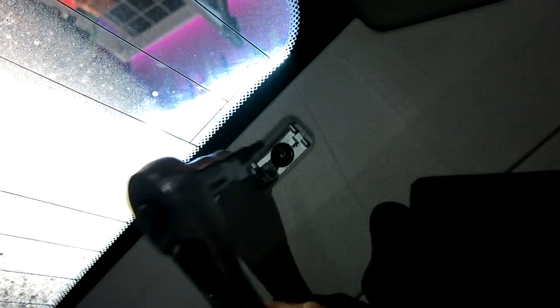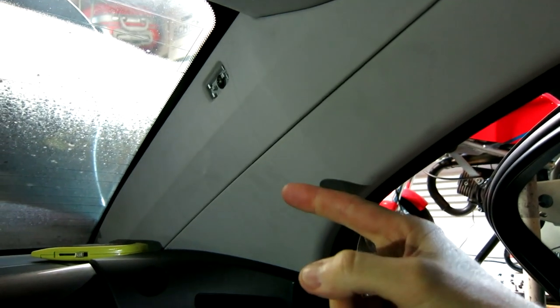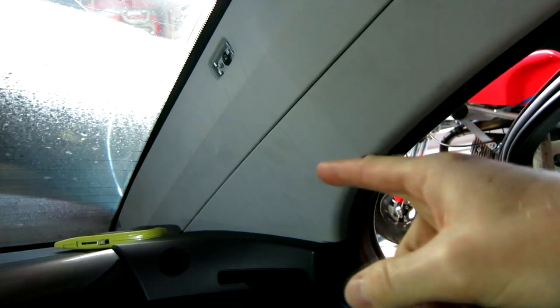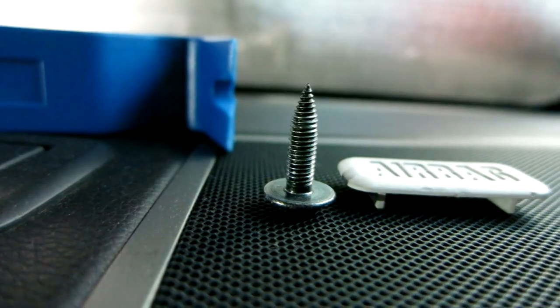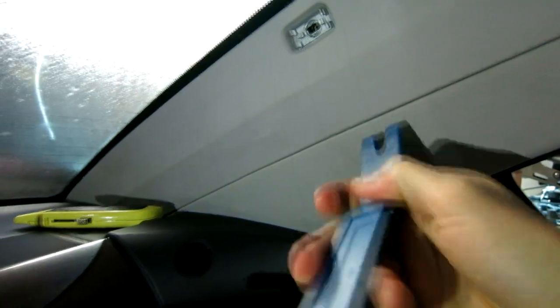Now we're presented right here with a T25. I repeat, a T25. Go ahead and loosen that bolt up, and then we're going to go ahead and pull this panel off right here. And if you do see scuffs and fingerprints, that was not me, probably a previous owner. Looks like someone was already working, maybe for the tint job. Their hands weren't clean, that's a shame. Might be able to get some Resolve or something on that to clean that up. Okay, the bolt's out. Now we're going to go ahead and remove our panel here. This is where you probably want your trim set here, and I'm going to do it with two hands. I'm going to get it underneath here, pop that out there.